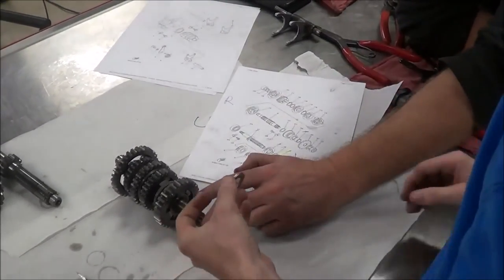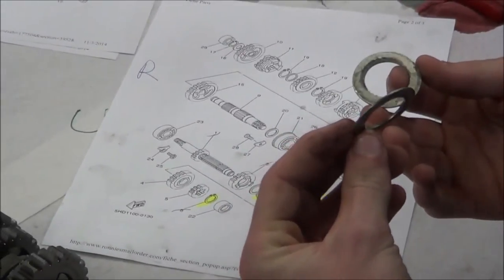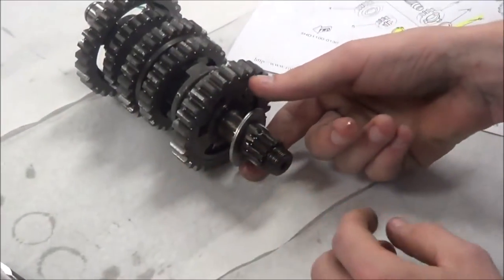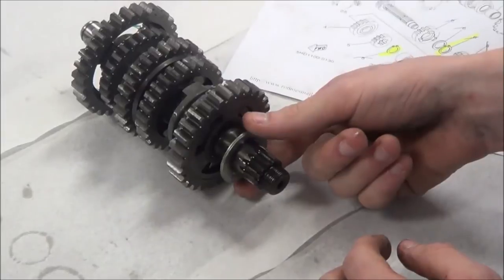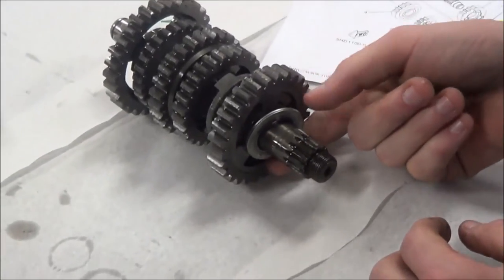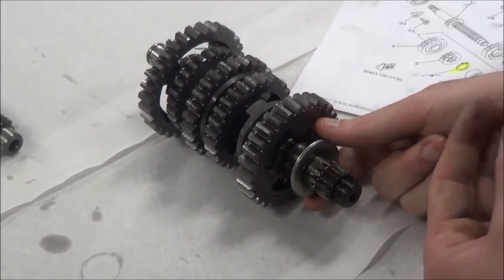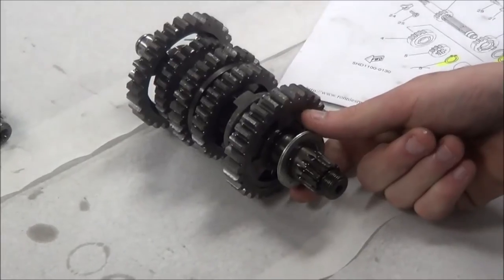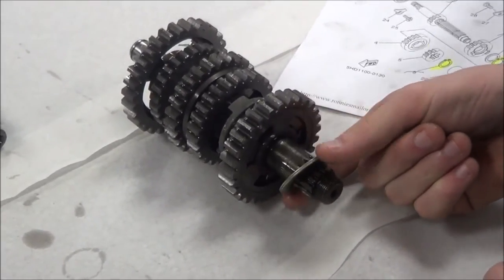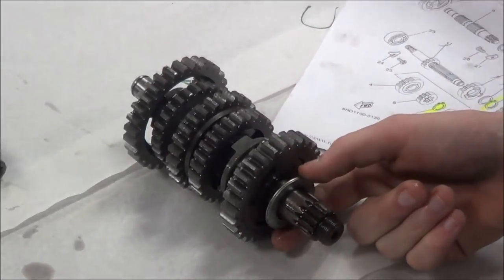And you guys understand that the bearing and seal was in the case, right? Now, here's why we think this is wrong, too. Put it back on the shaft. Go ahead and wiggle it up and down. Do you see that whole big gap in there? Man, it's a Yamaha. Are they going to have that much slop? No. How much do you want to bet that they lost that and just decided to throw it back together and went to Baumgart's or something and got a couple shims? Mm-hmm. Okay, the problem we have is that offset the whole transmission. I think that's what caused the damage to a shift fork.